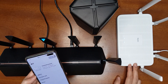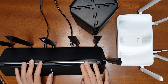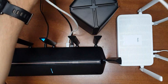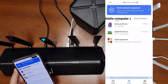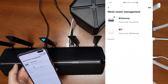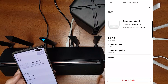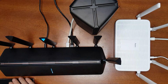If you want to connect these two nodes using a wired connection you can do so — just connect the LAN cable from the AX3600 to the Redmi AX5, connecting it to the WAN port of the child router. Now with the wired connection established, the mesh networking management shows the connection type as 'cable'. It automatically changes from Wi-Fi to cable and gives preference to the cable connection.